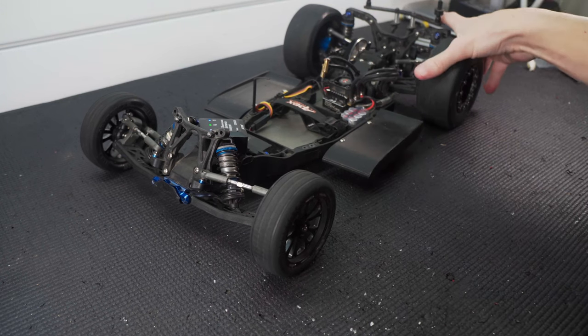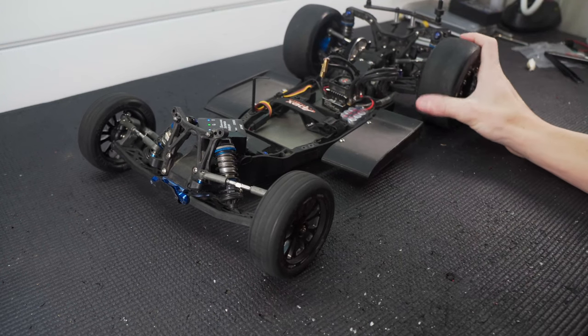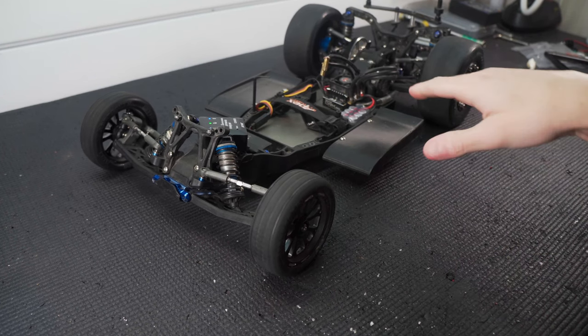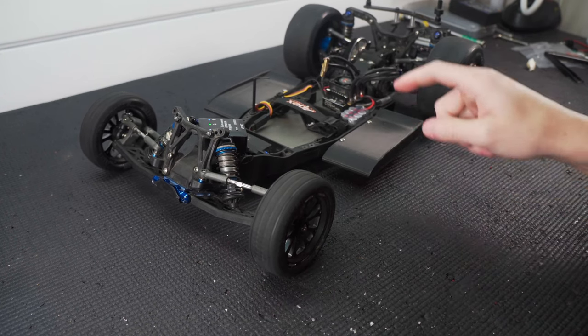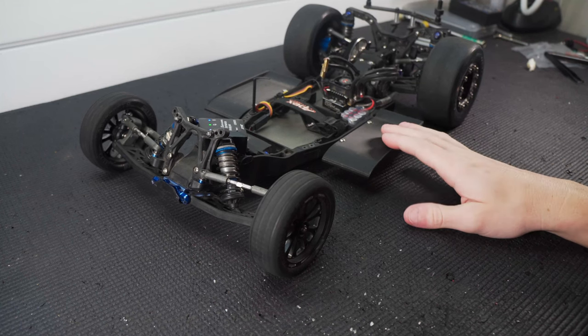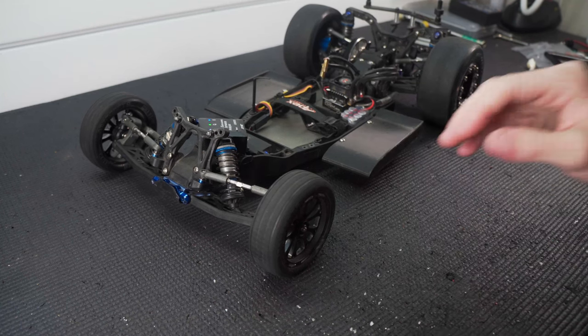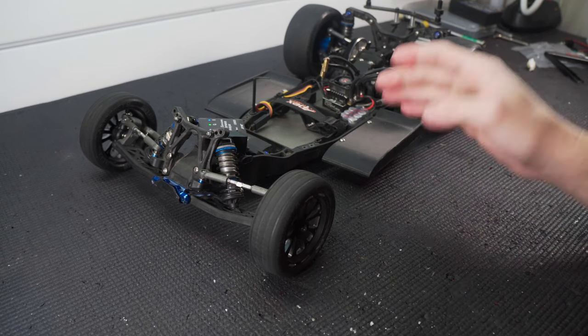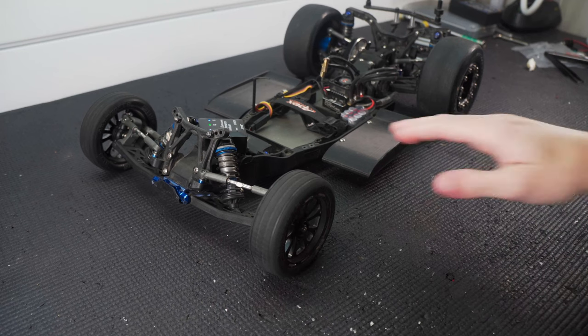Like I said, I want to do some tire conditioning. That way we don't get those squiggly launches anymore. No trouble off the line. And once we get tire conditioning down and I can maybe put a little more power down on the hit, maybe we'll start seeing closer to like a 2 flat or closer to like 65 miles an hour. And we can get some more speed out of this thing, get some better passes.